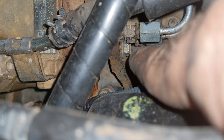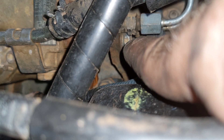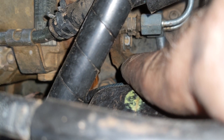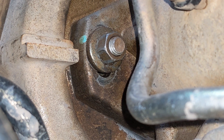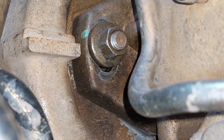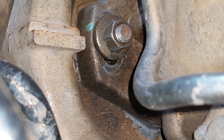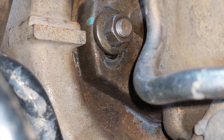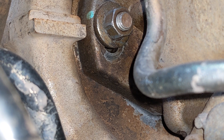See that little nut below these fuel lines? You can undo that, and then you can clock your injector pump. We can see here it's all clocked. It looks wrong from this angle because I'm a bit below, but that line lines up with the marking on the timing gear cover. That all lines up. We can tighten that down and it should be running tip top.